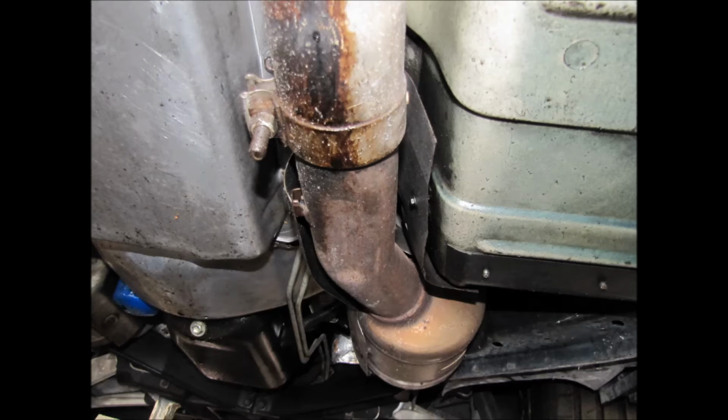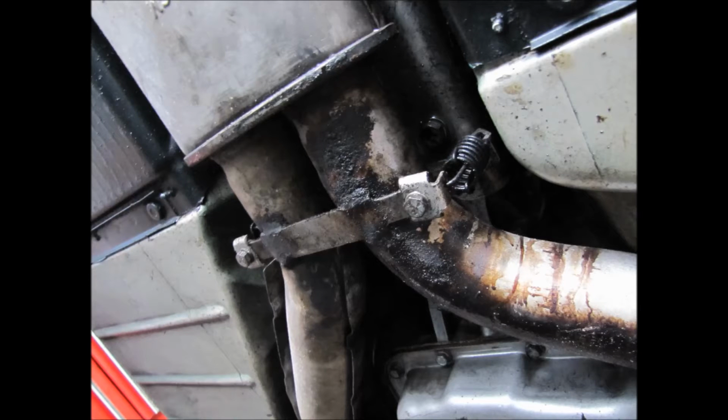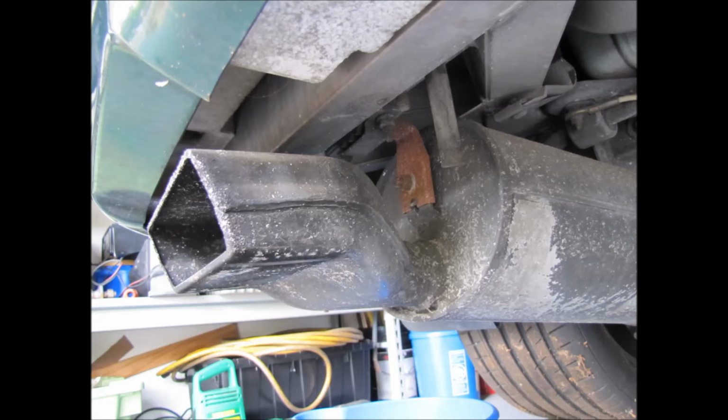Okay, toughest bolts will be the ones connecting the exhaust manifolds or headers on the Corvette. There's 3 bolts and nuts on the driver's side holding a coupling in place, and a band clamp holding the passenger side exhaust together. All the bolts and band clamp are 15mm. The bottom 2 of the coupling are easy to reach. The third on the top, however, is a pain.